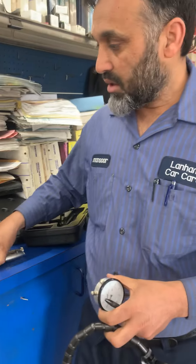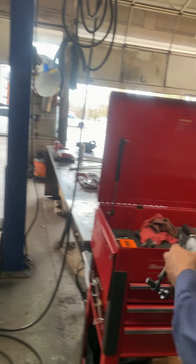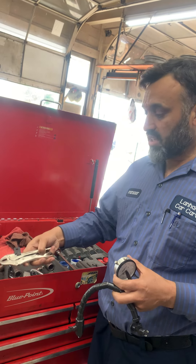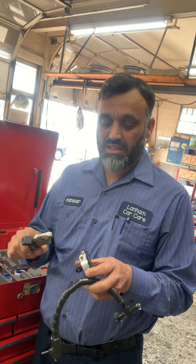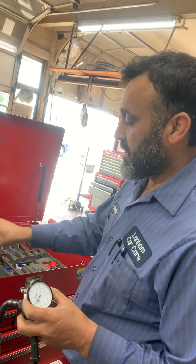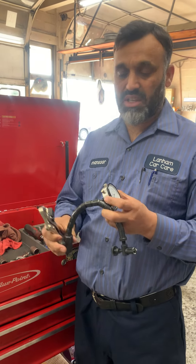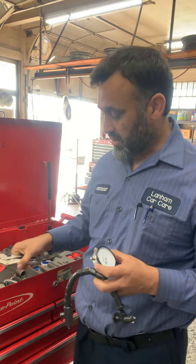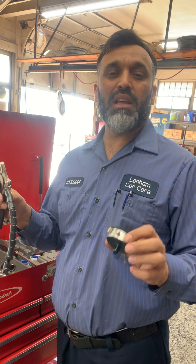This is the dial face, this is the bezel, this is the stem, this is the plunger, and this is the contact point. This is the flex arm. Let me make a demo using this box. We will assemble all three devices — I will show how to assemble them here, and later when the time comes I will do the same demo on actual cars. This device is used to diagnose the play in the ball joint.